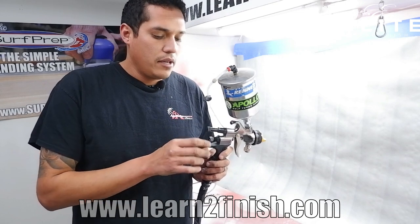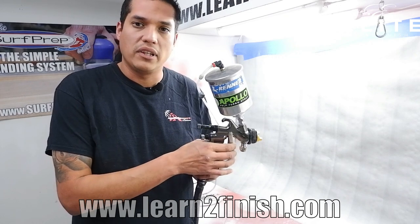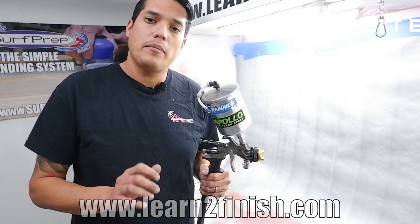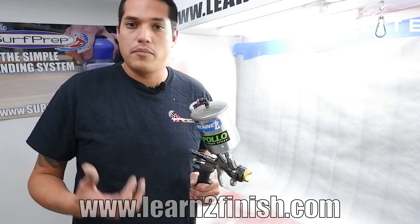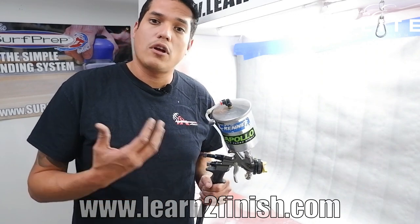I have my turbine set at half speed, so on the Precision 5 it's right at half. I want to see where I'm at. I'm going to have my material all the way in — closed completely. I don't want any material coming out of this gun at all. The reason I'm doing that is I'm going to slowly back it off to see when I get that perfect spray pattern. When I turn the turbine on and put my respirator on, you're going to notice me slowly backing that off. Alright, let's get started.